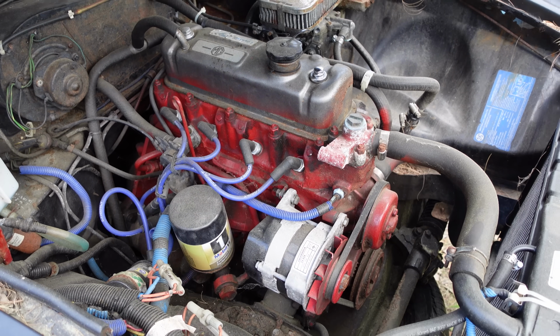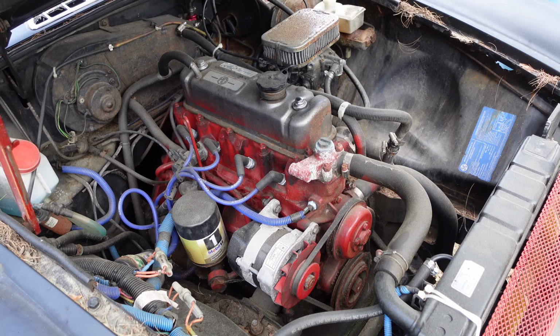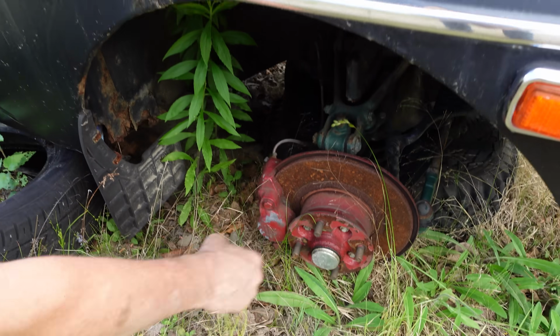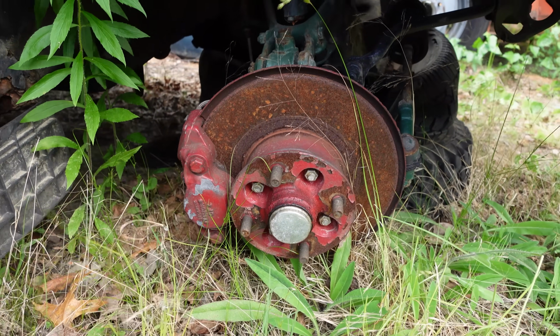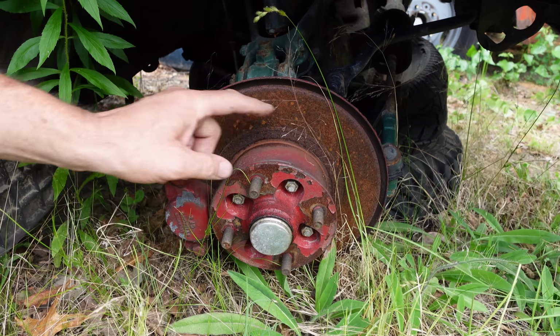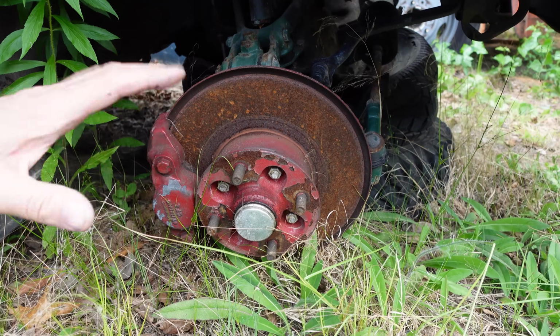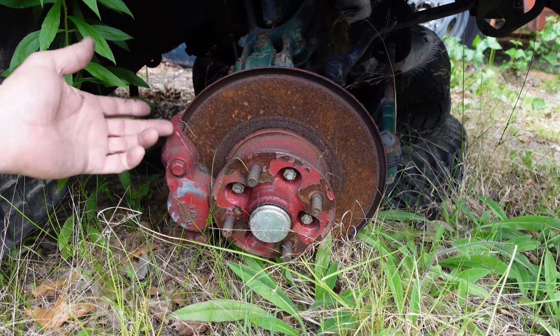Now, again, the MGB always came with disc brakes up front, and they were a major improvement over what came before. 11-inch rotors, just as big as anything you'll find on a Roadrunner in 1968 up, the optional discs. These are big. They're not vented. This is a solid rotor, but again, this car is light enough to where the heat soak in this thing won't cause too much overheating and warping. So in other words, no need for a vented rotor, which would be heavier.